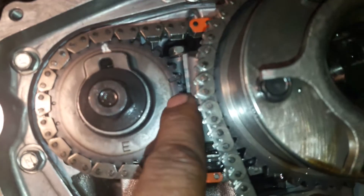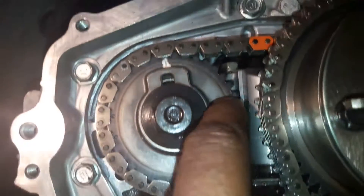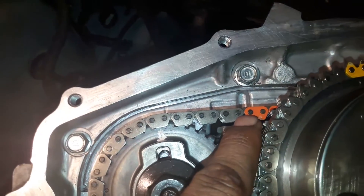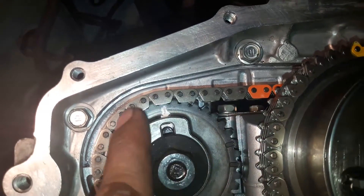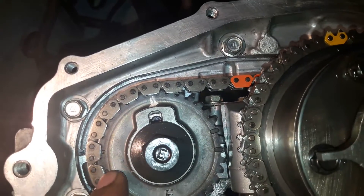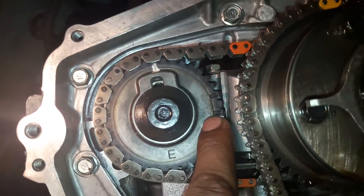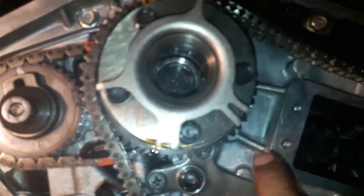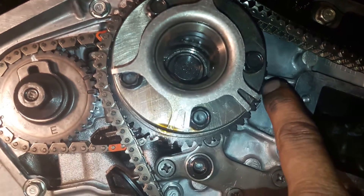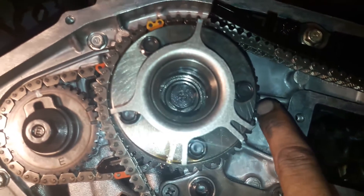On the opposite side there are already two long dot marks, but you need to select the two dot marks on the timing chain — not the two long dot marks. This single chain mark is put on the inlet cam sprocket.